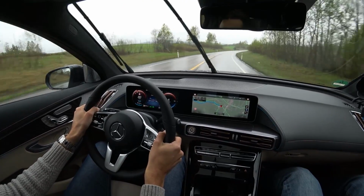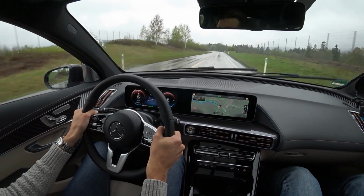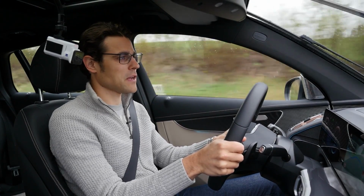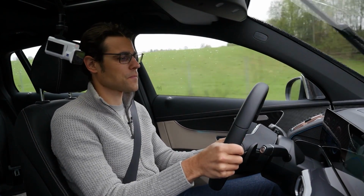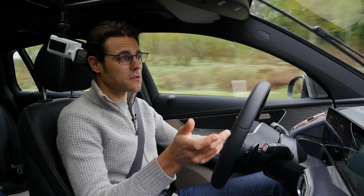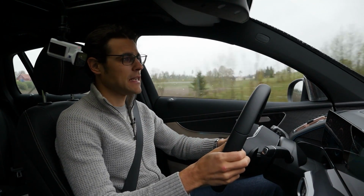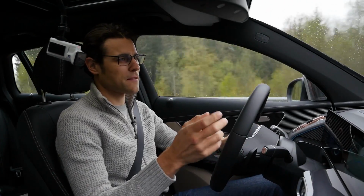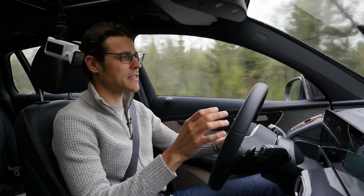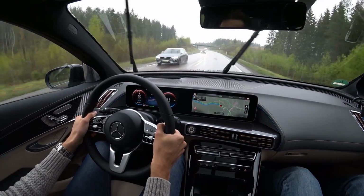20, if you have some acceleration in there, is surely a realistic figure, and if we think about 20 kilowatt hours per 100 kilometers, then it would indeed be some 400 kilometers in range, or about 250 miles, as a realistic figure. And I'm pretty sure we'll also reach soon about 20 kilowatt hours per 100 kilometers here. That's somewhat okay. You can always use more range, but more realistic is that you quite often charge the car when you have the fitting infrastructure, and then it does not play such a big role if it's 50 kilometers more or less, if you have at least something like 400 kilometers. I think 400 kilometers, 250 miles, you need to have that. Everything below that, you might get in a lot of situations where you have problems, even if you have a rather average driving profile.